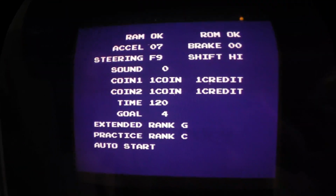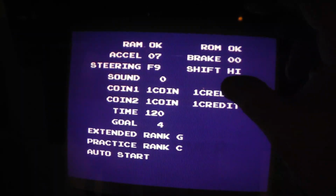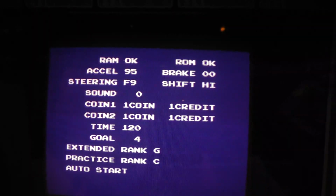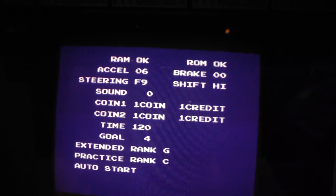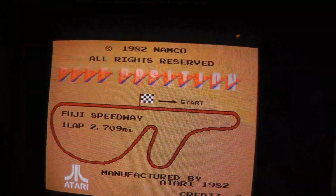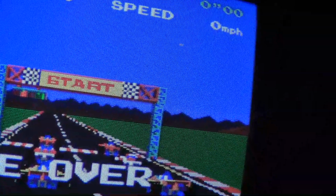This is kind of interesting. I put it in test mode, and while I was doing so, I was holding up the pedal. So I held up the pedal a little bit, and you can see it doesn't return to 0, but if I press it down, I'm getting all the way to 95. But I didn't notice any difference with the new cable in there. But I did find that interesting. So maybe as you come out of test mode, I've got my socks on here, just hold the pedal up maybe. Make sure you get maximum 0. I don't know.